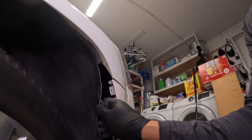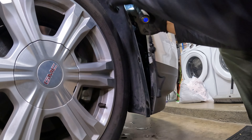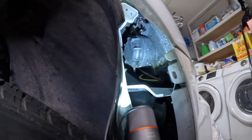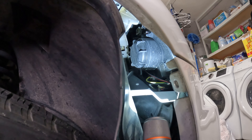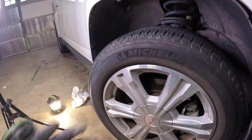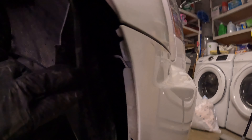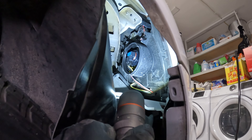From this point on, it is very, very tight — barely enough space to push your arm in there and remove the light bulb. That there's the cap for the low beam. You unscrew that cap. Here's how the cap looks like — it has a rubber gasket. Very hard to remove because of the tight space. And then you have the original light bulb right there.